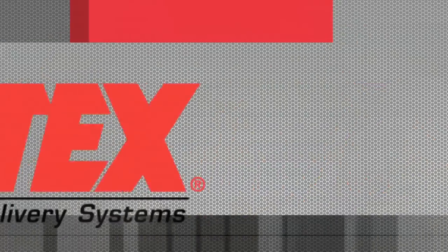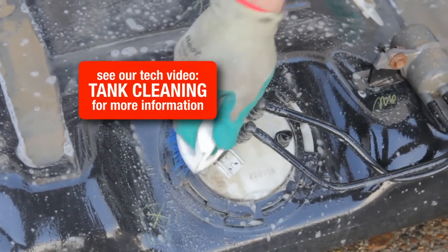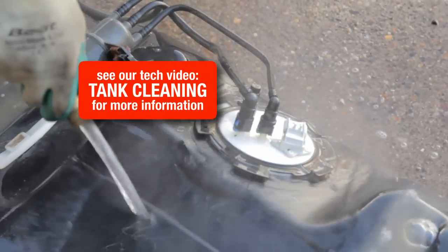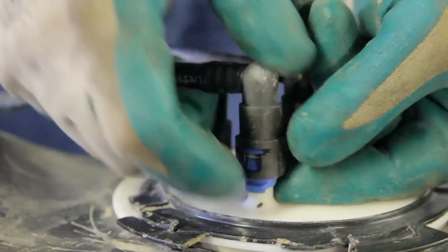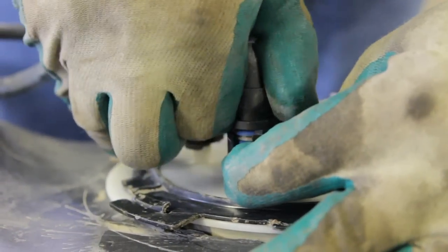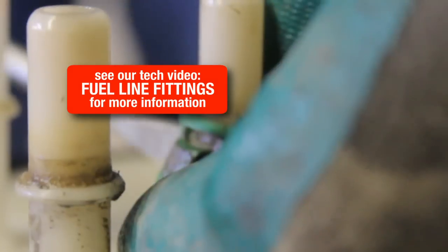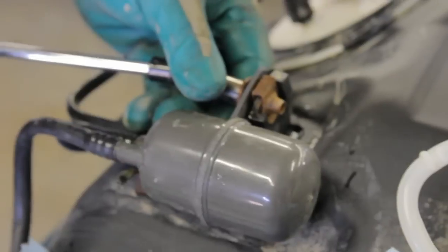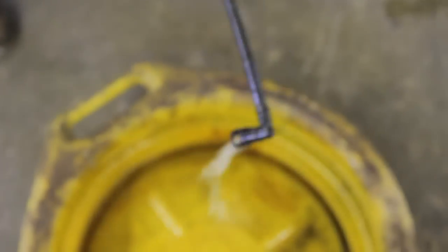In order to keep debris from getting into the tank, we need to clean it with mild detergent and water. Now that we've cleaned the outside of the tank, we need to remove the fuel lines, which are a pinch type connector. We will need to remove the retainer in order to reuse it on the new module. Remove the fuel filter — the fuel filter will have fuel in it and we will need to capture that.